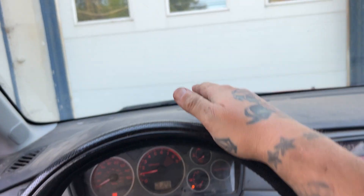We've got the MAC valve all installed and we're letting the car warm up. Duty cycles are all zeroed out. I'll do a small pull in second gear just to confirm it's reading 18 psi with it zeroed out, then I'll start adding duty cycle. Winter is really close and I'd like to have this mostly done. I also want to put some pump gas in it to run through the injectors to clean them out a bit and store it with pump gas — better for our climate.